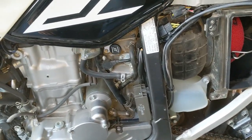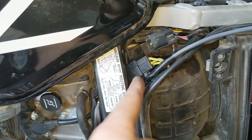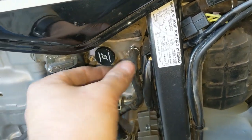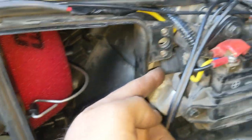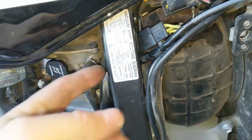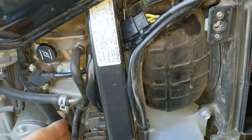Okay, we're back at the bike and I've got it installed. I'll show you how I routed the wires. This yellow clip is going to be one of the larger pieces you'll have to push through on this side of the frame. What I found helpful was to remove the breather from the carburetor — just pull it off — to give yourself room to get the connectors back up as well as the fuse. Make sure you're pushing from the connector, not pulling. This old plug is no longer going to be used, so we're going to tape it up.